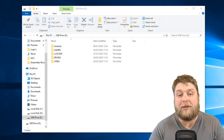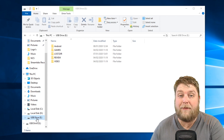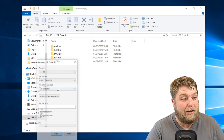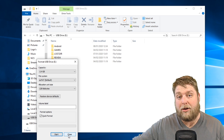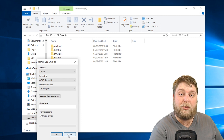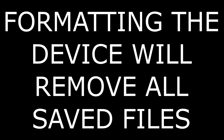When you first plug the USB into the PC, you're going to see the USB drive come up. You may need to right-click and then click on format — you may need to change it. This one is currently exFAT; usually they tell you to have it as FAT32. But when you first plug the USB storage device into the Fire Stick it will ask you to format it anyway, so that will do it for you. Do bear in mind that if you format the device it will wipe it clean, so make sure you've got things backed up or you don't mind losing them.